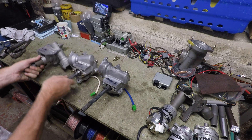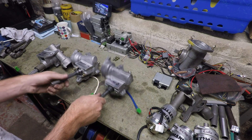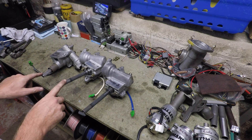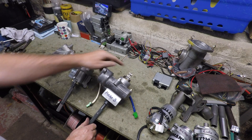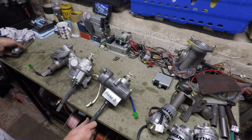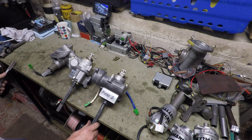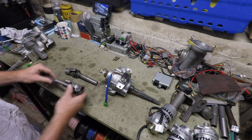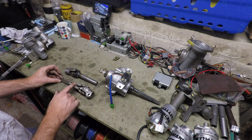All three are very similar in size, all three have a splined input shaft, all three have a splined output shaft, and all three use the same lower joint setup. You get two universal joints and a link shaft.